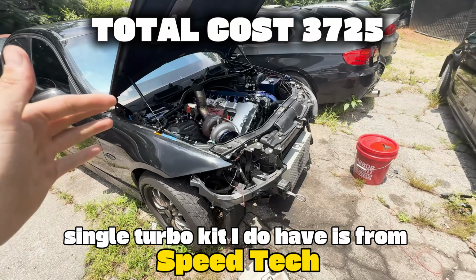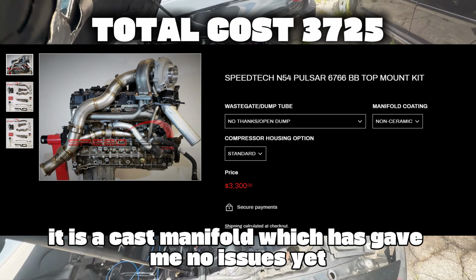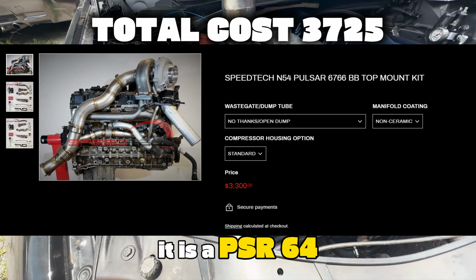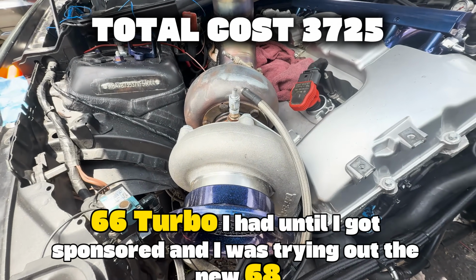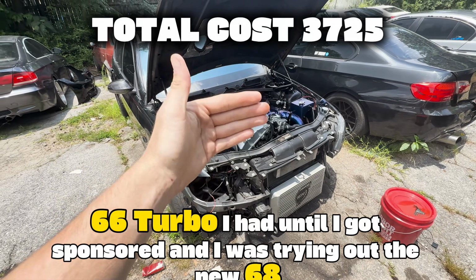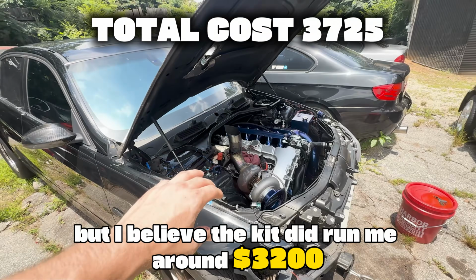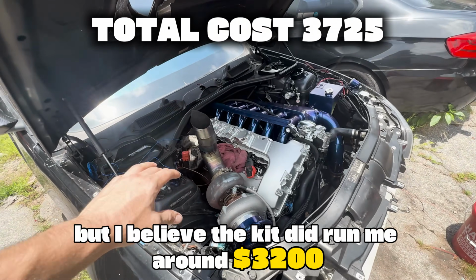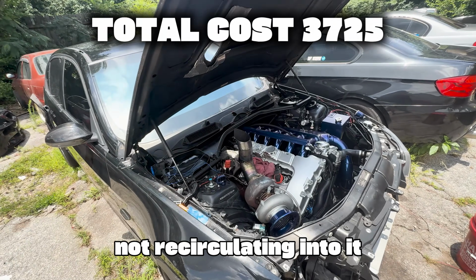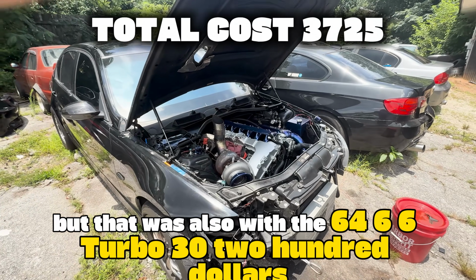The single turbo kit I do have is from SpeedTech, probably one of the cheapest routes to go on the N54. It is a cast manifold, which has given me no issues yet. It is a PSR 6466 turbo I had until I got sponsored and was trying out the new 6870 Pulsar turbo, which is currently on the car right now. But I believe the kit did run me around $3,200. That is the top mount kit with the wastegate dump, not recirculating into it. But that was also with the 6466 turbo, $3,200.